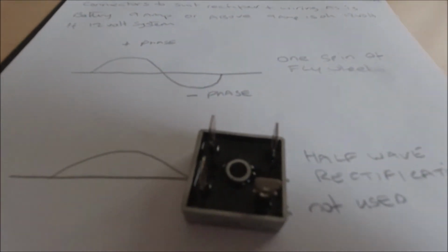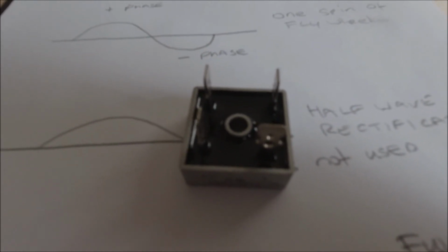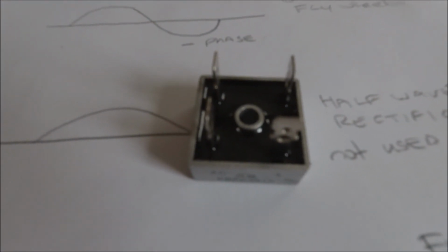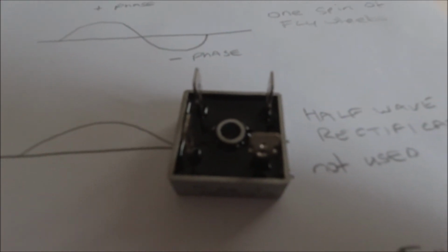It's not rocket science. The actual system is just using the full wave rather than regulating half a wave, which is what that beastie does. That's just a bog standard solid state rectifier. You can actually make that out of 4 diodes if you know how to wire it, save money. But that fits inside a regulator box quite easily, as fitted to a GS.